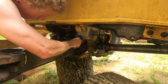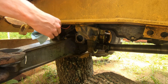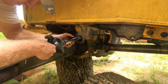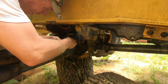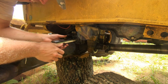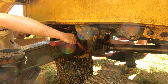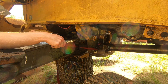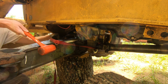Make sure to clean out that hole, then slide the shaft in and tap it all the way down. Our seals are nice and fresh so we can't just push the cylinder back through on the far side by hand. So we hooked a ratchet strap around it and slowly tightened it up and beat it in there.